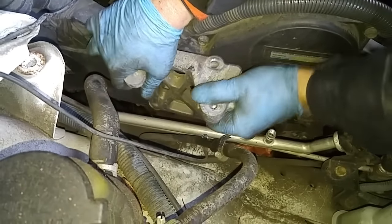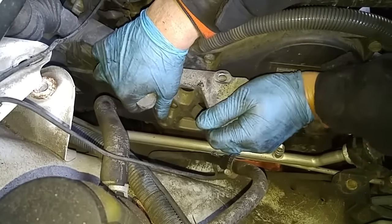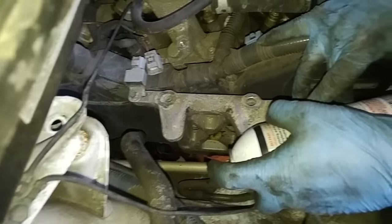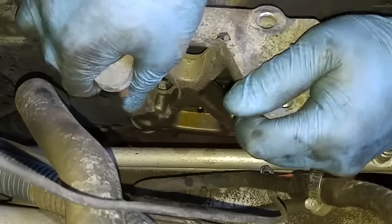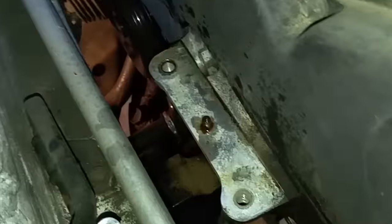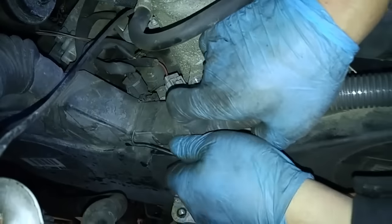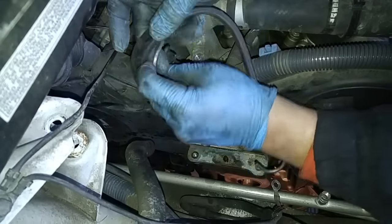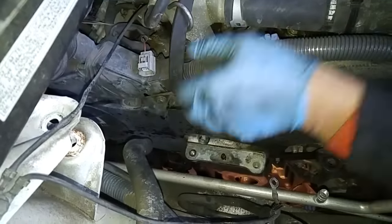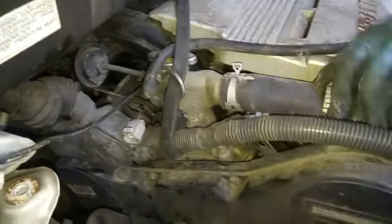Looks like aluminum corrosion — if there is corrosion, it rests on an alignment pin. I want to remove this wire harness away from the timing belt cover because it eases removal of both the cover and the camshaft when I remove the cam seals.